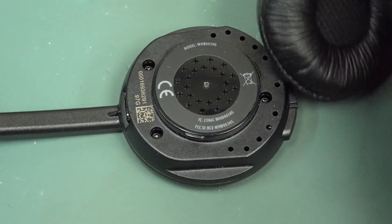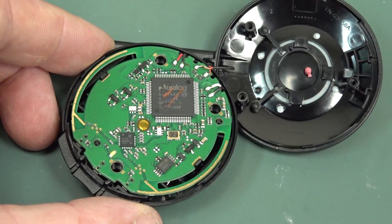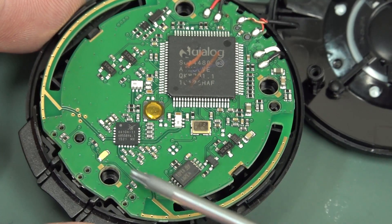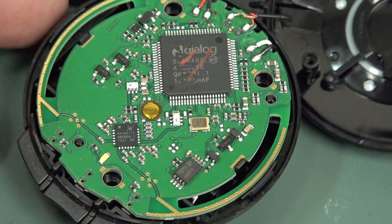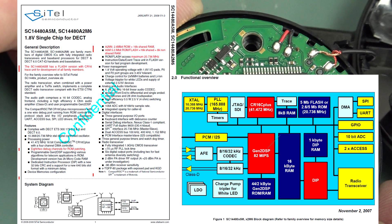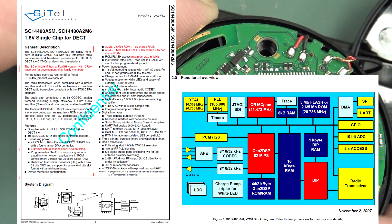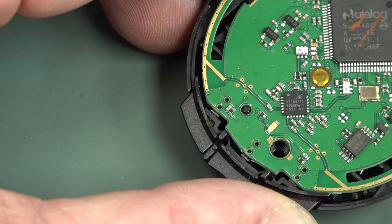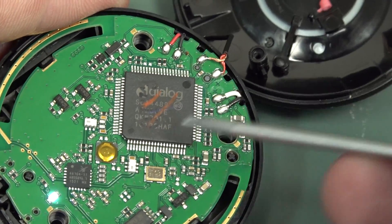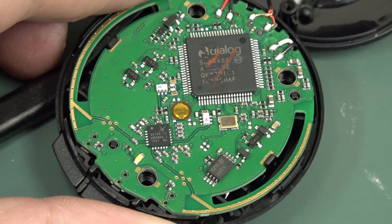We'll have a quick look inside this Jabra headset. The outer thing just plugs on there because you can just get replacements for that because they wear out and get all yucky. And that's about all I expected. Big single chip solution up there. We've got the Bluetooth receiver here — you can see that buggering off there. Dual antenna there, buggering off along the sides. That's a Dialog Semiconductor part, which is actually formerly Cytel. And here's the datasheet: Confidential. None of that NDA rubbish — we've got the good stuff here. It's a single chip solution designed exactly for these DECT applications. There's a little itty-bitty tactile switch down there that turns your power off and on.